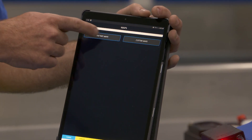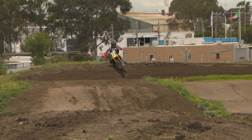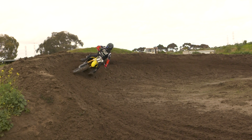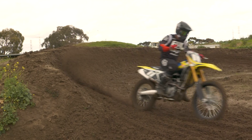The Wi-Fi tuner allows you to tune the bike to suit different sorts of terrain on the track — from a hard pack surface where you want the power a little bit softer so it hooks up better, to a loamy surface where you want maximum power so you can get full drive out of the corners.